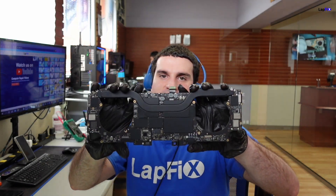And before it does that, it needs to go through lots of different steps. So sometimes if this gets damaged, we need to reload that type of firmware on there. By the gracious goodness of Apple, we do have a solution for this — even though it's not the perfect solution, it still does work. We see it work sometimes. It's called DFU mode, and it's going to be doing exactly what you want: reloading the firmware. We're going to be attempting to do that. Usually there was damage from a liquid spill or something that causes this to happen, and now you're just stuck in this loop. So we'll put it back together so we can allow our DFU mode to come up, then go into the process of doing the firmware restore.